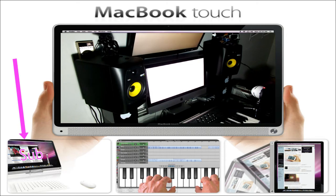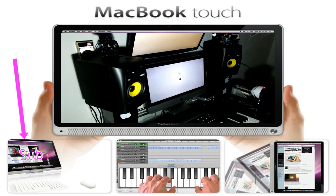They say do it like once a month, but I do mine like twice a month because I'm always on my computer. So like I said, you just shut your computer down, start it back up, hold down Option, Command, R, and P. You're going to hit that first chime, then you're going to hit the second one, and when you hit the second one, let it go.